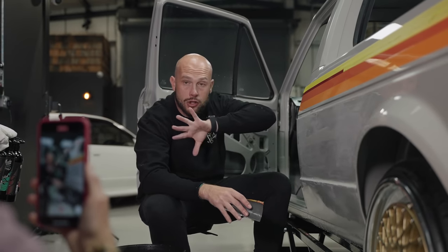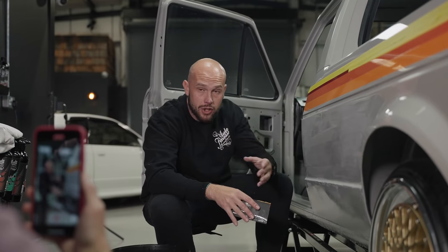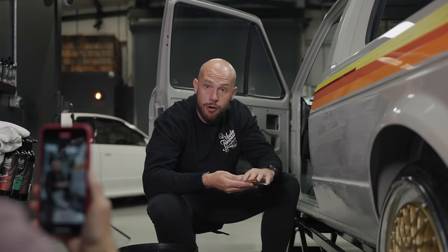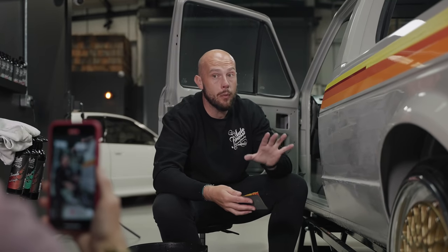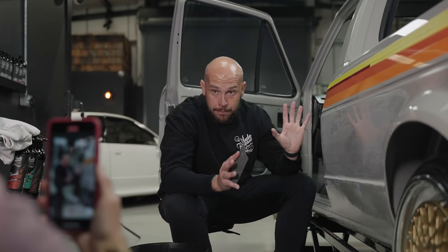I'm happy that we've got to the bottom of the texture now, so I'm just going to follow that up with a finer grade. This is basically to remove the scratches that we've just put in from the 1500 and refine those down a bit. Then we'll do the same again but with a 3000 disc on an air sander, and then it should be flat, it'll be matte, but then it'll be ready for polishing up.